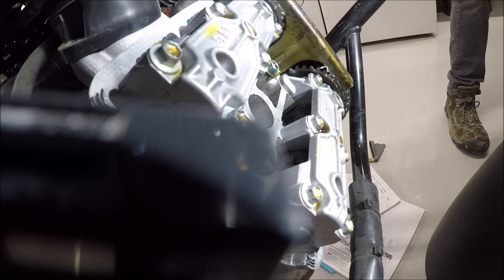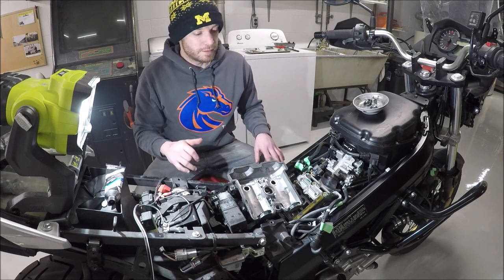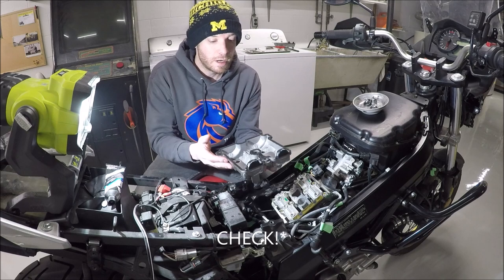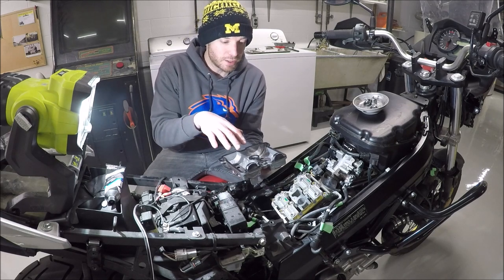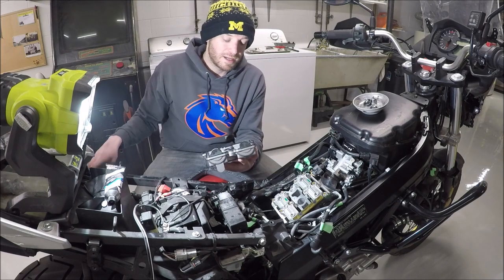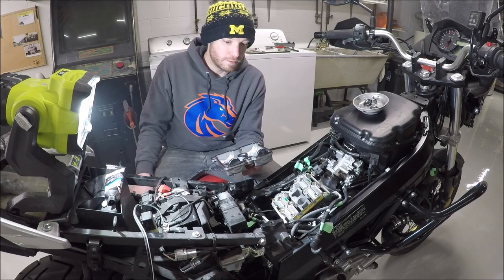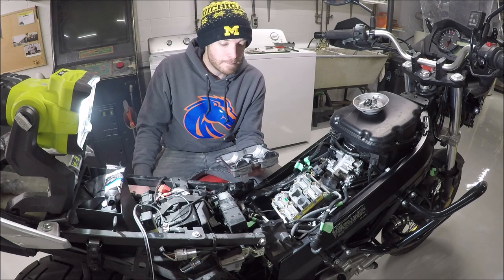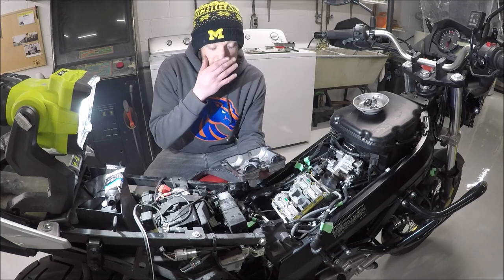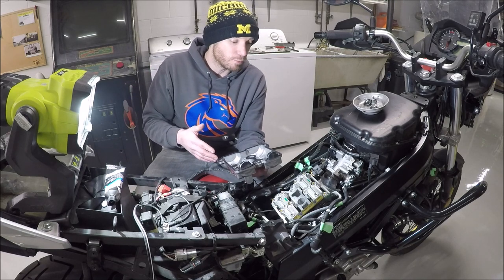That's a valve clearance check — we're basically done. I'll walk through the finishing up. To finish this thing up, I just have to put the bike back together. I'm not actually going to seat this valve cover because I've got it in my head that I am going to adjust my clearances. I think I'm going to do the shim adjustment — I've got four months before it's even going to be able to ride outside. From what I saw on the clearances, we're fine within spec.